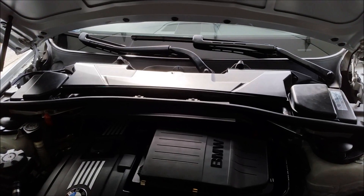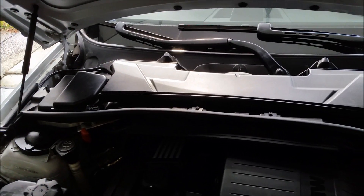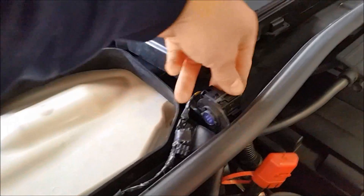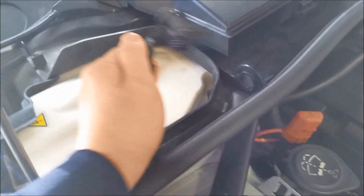Now we're at the front of the car and we're going to have to move the cowl cover to get to the ECU. Pop this off, pop this one off — it's the ECU cover. We're going to turn this little clip for the sensor and move it out of the way. Remove the 8mm bolt there and the one on the other side — there are six bolts on this — and now we're going to pull this off.